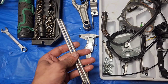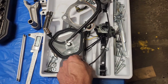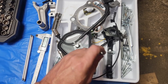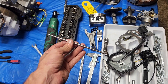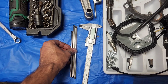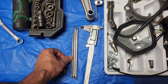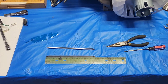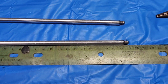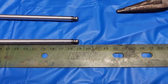The pushrods are definitely way bigger. We'll have to do a check on whether they're steel or aluminum with caps. A 440 uses the exact same size rod as a GX390, which is why all the parts interchange. That, on the other hand, is most definitely not the same size. They were bigger than my calipers so we used the old-school ruler — they are right on the money at 19 centimeters, so 190 millimeters.